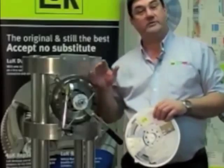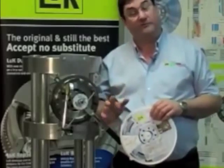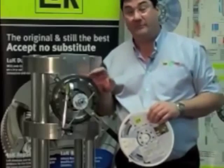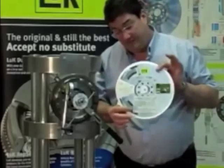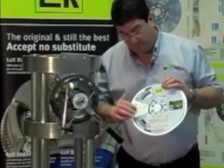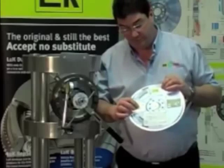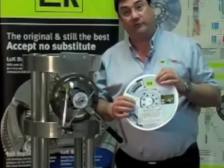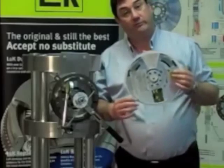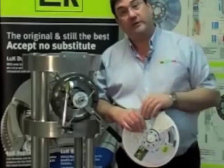Once you've measured those two important values, it's important to find out what the maximum value is for your particular flywheel, because they do vary quite a bit. We've produced a handy data wheel that gives you a list of all of our flywheel part numbers, what the maximum free play is, what the maximum rock is, and whether it's fitted with a friction control plate or not. Those are available from your local motor factor. And that concludes our presentation today — thanks for watching.